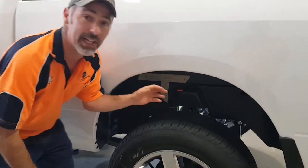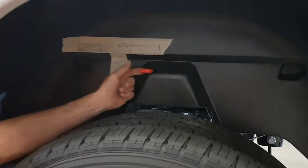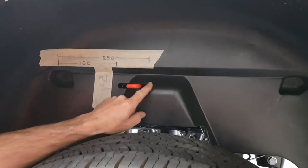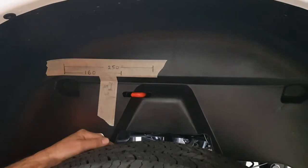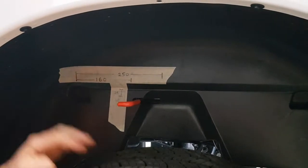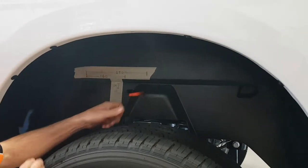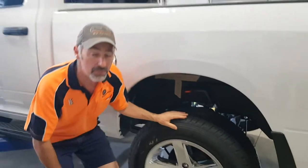Just while we're here, before we lift it up and have a look — the pull handle for releasing the ball. The guys have cut a nice little notch here and I've put some measurements on there. When you want to release the ball, simply pull and lock. You can pull the ball out and then reverse and that'll fire back in, keeping the ball in while you're towing.